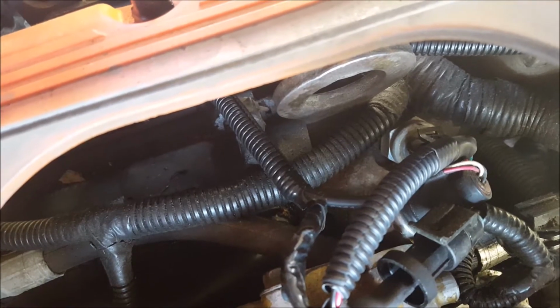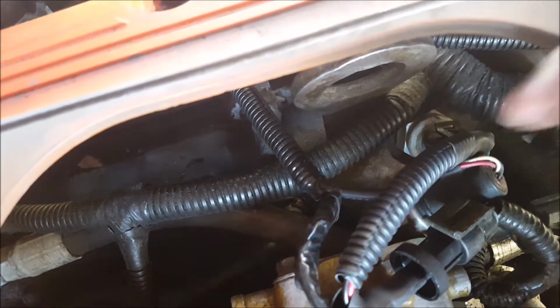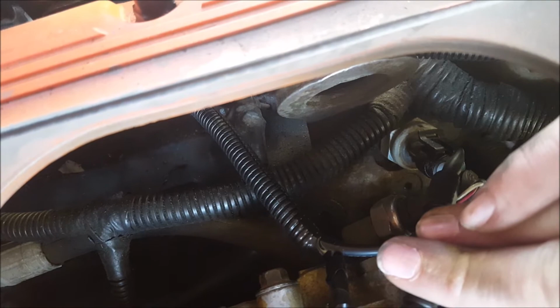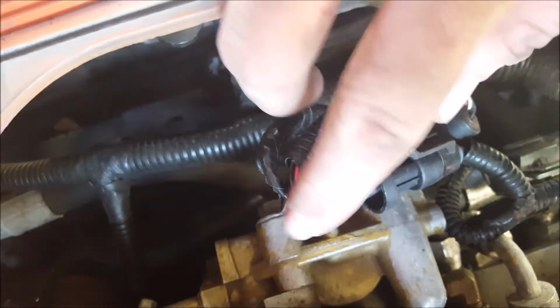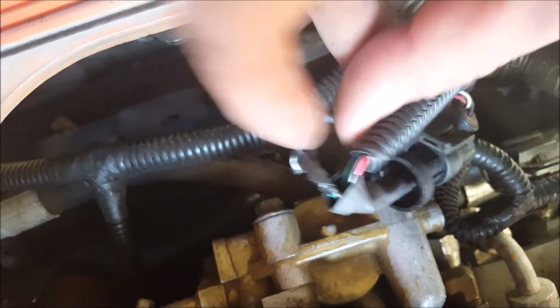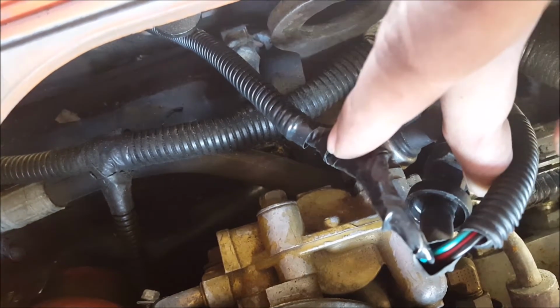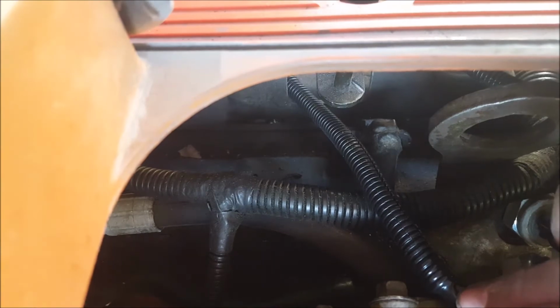For the high oil pressure sending unit, I purchased the Pigtail harness from Glowshift, and I plugged it into the ICP coming off the driver's side head on the 7.3 here. I took where the truck was plugged into the ICP and plugged it into the other end of the Pigtail harness. Here is where the Pigtail makes a Y, and I butt spliced the wires of the harness to the wire going to the back of the gauge. Put some shrouding on that wire and ran it into the firewall.